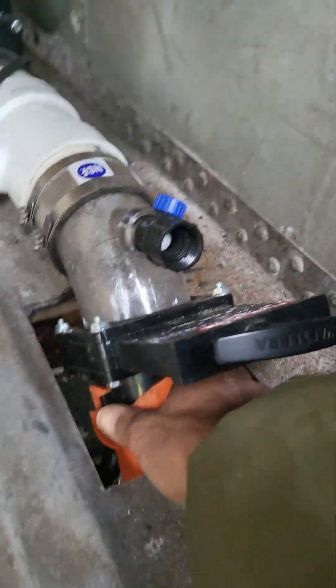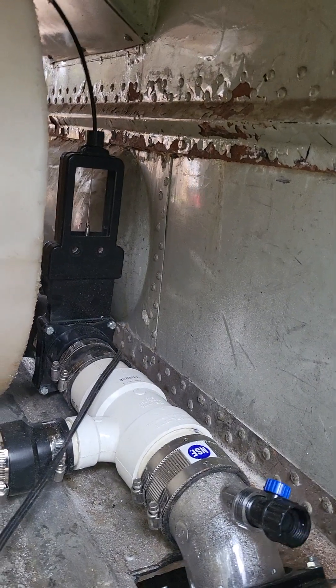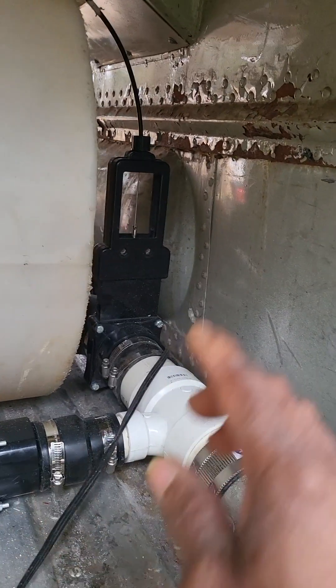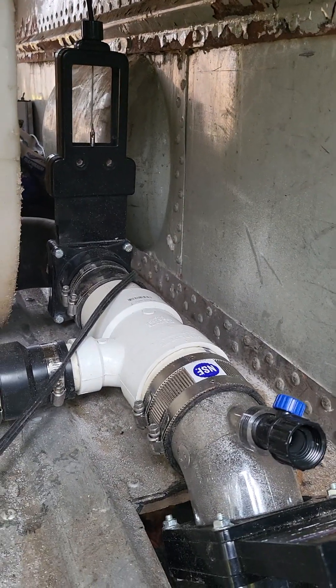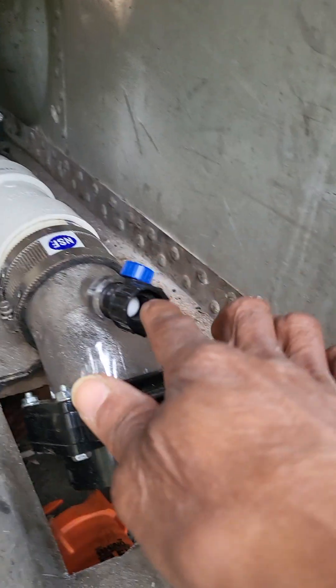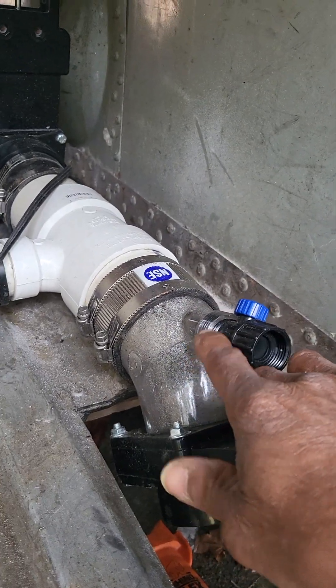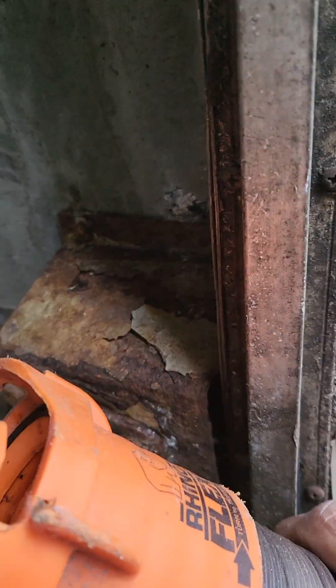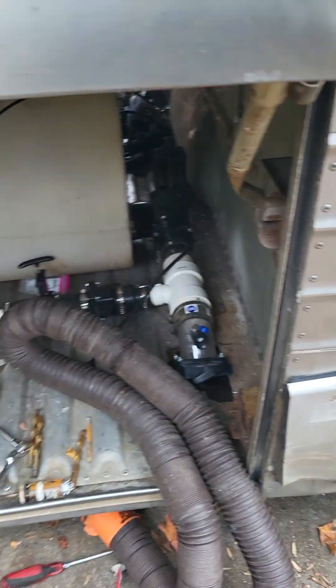When you get finished, you just pop this off. What you do first is open up and let the sewage out. Then once you let the sewage out, close the sewage off and open up this valve here — it runs gray water out of this tank to wash all the sewage down the drain and also clean out the pipe. That's why this clear section is here — so you can put a water hose onto it and see what it's doing, washing from here all the way out of this pipe. Once it does that, the pipe will be clean, then you just roll it up and throw it back inside.